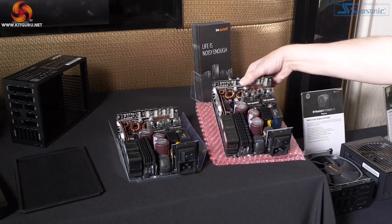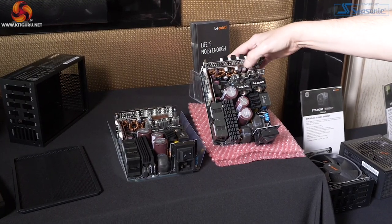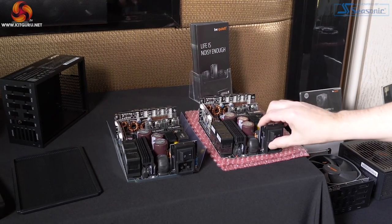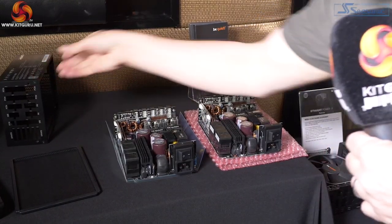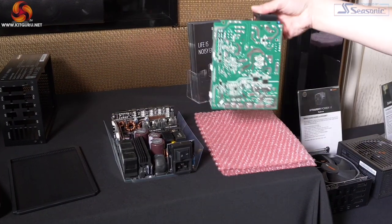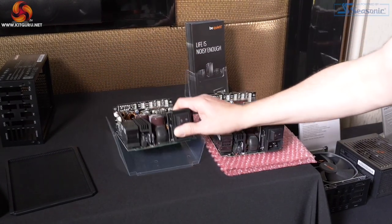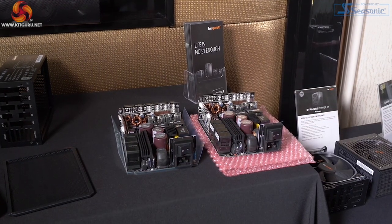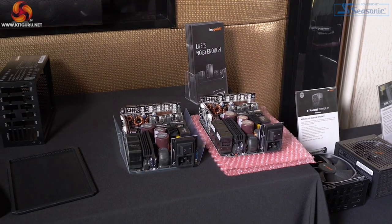The internal design is practically wire-free — those are the only cables inside this power supply. It's got enormous heat sinks, but it's been pointed out that although the chassis is made of aluminium, it is not intended to work as a heat sink. The chassis has a plastic shield around it so it doesn't actually have thermal contact with the metal casing. The aluminium casing is more of an aesthetic thing — we like aluminium, but it's not going to help the cooling of the power supply.